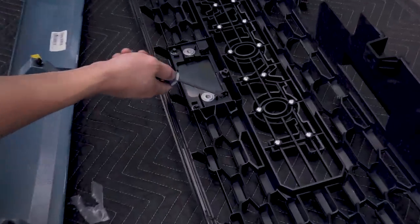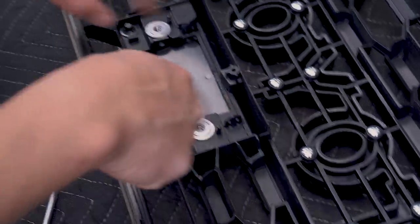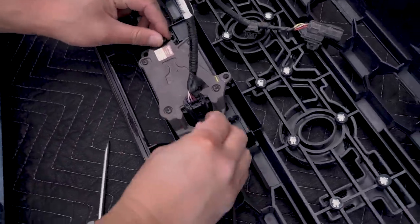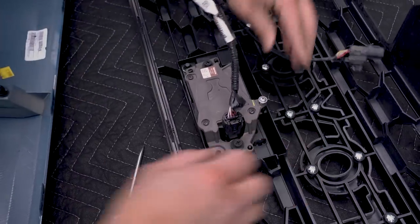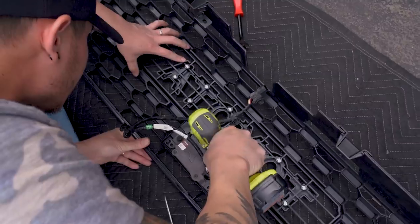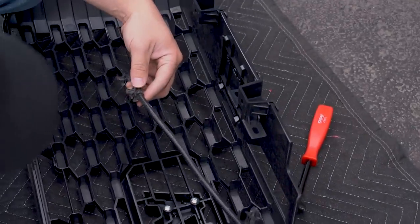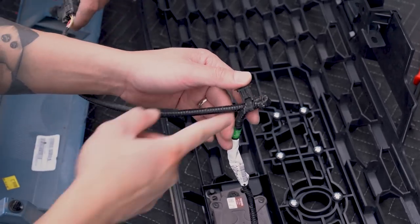Also the TSS garnish has these two tabs up here — it has a little tab that hooks onto the grill itself, so that's an extra securing piece. The TSS sensor really only goes in one way, so you'll see that pin go through there. And then these bolts will go through the square nuts that we took off the OEM grill. Get those started by hand, and then we'll just use our drill — turn it all the way down so that way it doesn't break plastic. Now once we have all three — one screw and two bolts in — we just have to route the harness. That way it's nicely tucked away. Since this was zip tied together for the sport off-road grill, we're going to need to cut that.